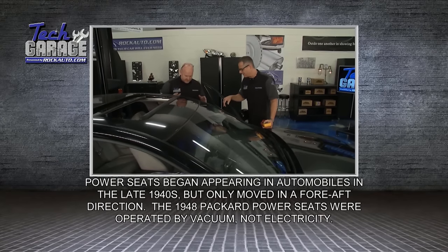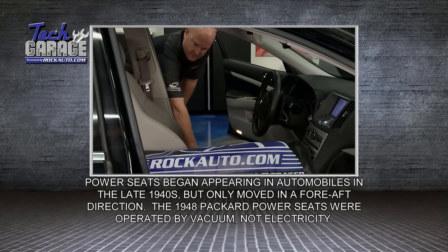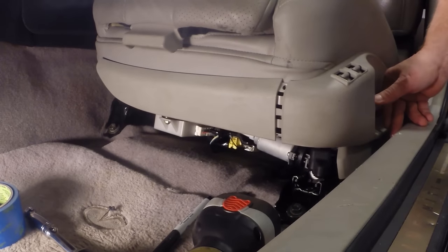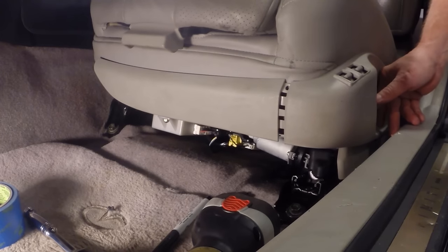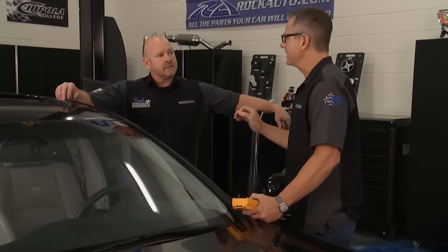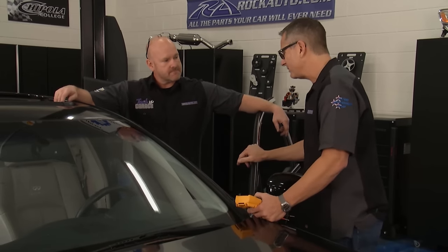I just don't know what's wrong with it, but you can give it a try. Let's verify what you experienced. The lumbar is going backwards and forward just fine — that looks to be okay. But if we try to slide it, there's a crazy twist going on here. No way that's going to work. That crazy twist gives us our strategy-based diagnosis: it's moving, so we probably have a mechanical or motor gearing issue, but probably not an electrical issue.